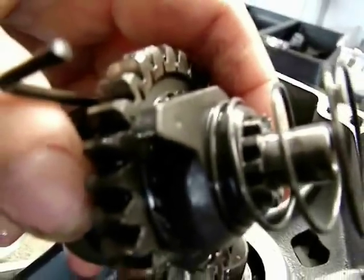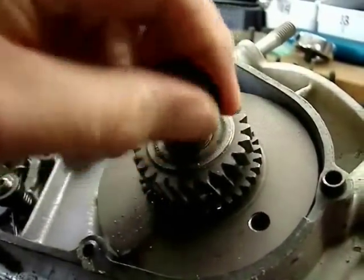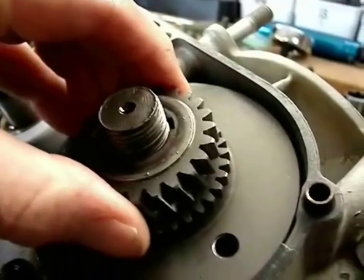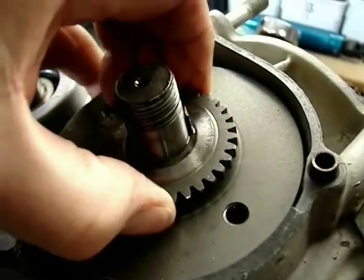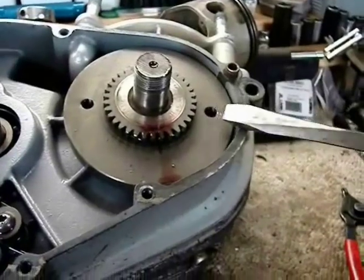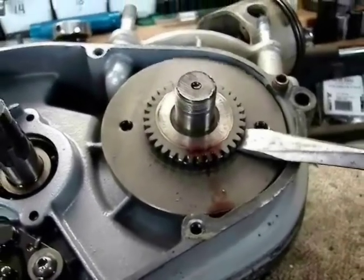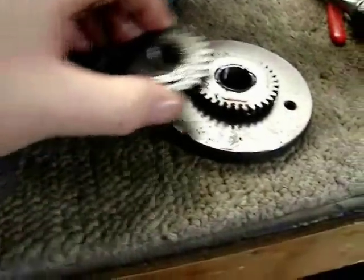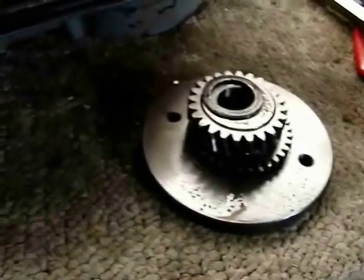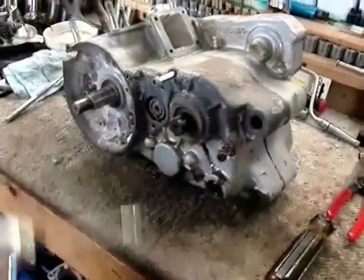That foot slides under that plate. I had previously loosened the big nut on the primary driven gear — this also drives your water pump in addition to your clutch basket. This is all on a straight shaft, not tapered, so it's not an interference fit, though it can stick a little. Keep these parts together as you take them off. There's a serrated washer, the big nut, a woodruff key, and the shaft is straight.